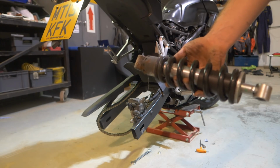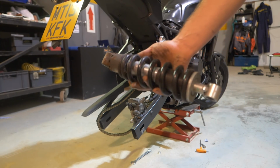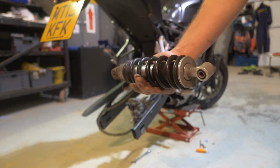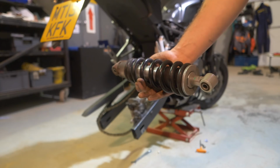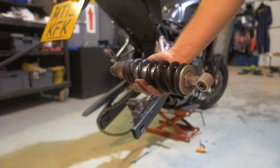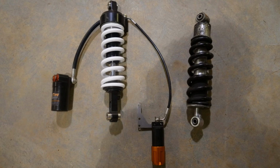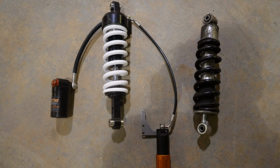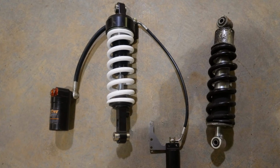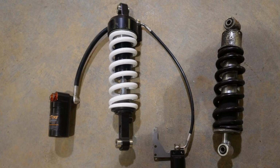So the rear shock, the actual unit we took out from the standard Honda, was very basic. There's no adjustment. It's a pressed steel construction shock. I think it weighs about 4.5 kilos, which is a fair heft of a shock. In replacement of that, we put the Tractive Level 2 shock. Your particular one has a piggyback reservoir, so there's an external oil reservoir for the shock.